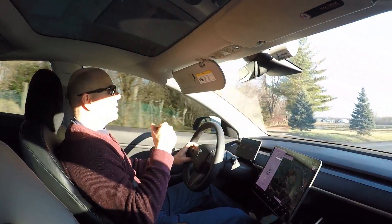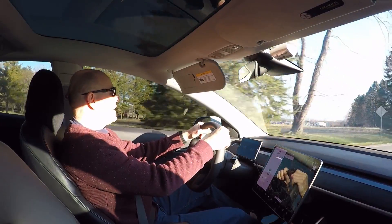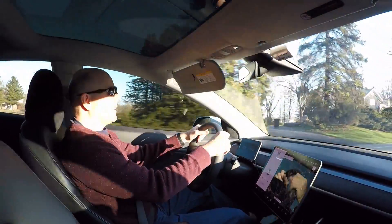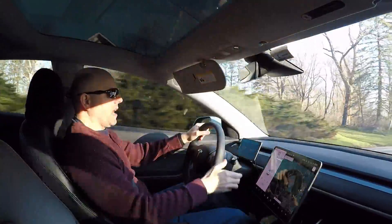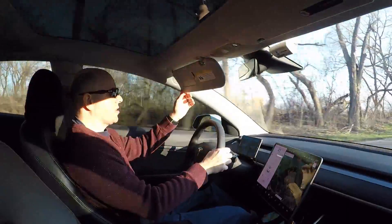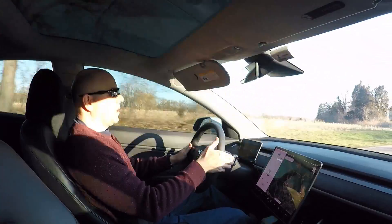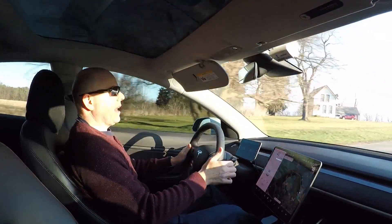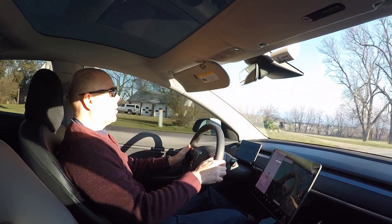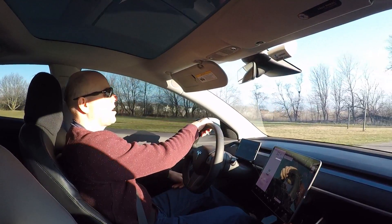It's a very disconcerting thing, but the solution is very simple: occasionally go ahead and use the mechanical brakes. When you let off, the regen is going to kick in and want to grab the brakes more than normal. So one thing I like to do is speed up a bit, throw it into neutral by pushing up and holding the shifter, then hit the brake. I'll do that three or four times to blow the rust off the rotors.